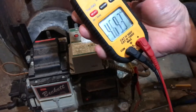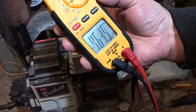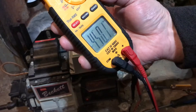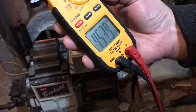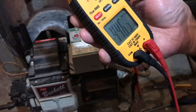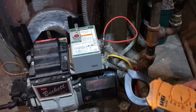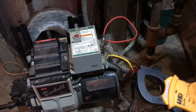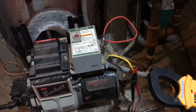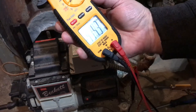Right now, if you can see that, I have roughly 464 to 465 ohms, which is excellent. I would recommend that even though the instructions say anything under 1,600, I've seen 1,500 to 1,600 ohms actually continue to lock out and cause a nuisance. My rule of thumb really is: if it's 1,000 ohms or above, change it out. If it's 1,000 ohms or under, you should be okay. That looks really good — 438 ohms. We're good there.